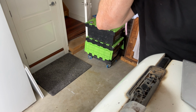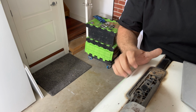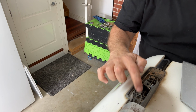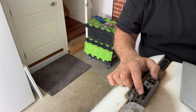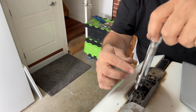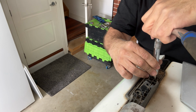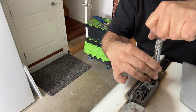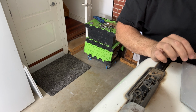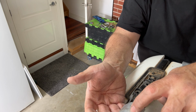All right, guys, so while I'm on the roof, obviously this is a Pajero Gen 4. With these roof rails, I just wanted to show you, there's two nuts that go into the roof. Obviously these haven't been tightened up in about 15 years. It's just 10 mil. I've already tightened them up, but just give them a bit of a tighten up. Don't go too hard, you'll ruin the thread.